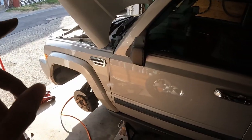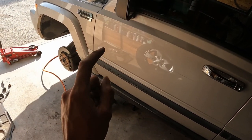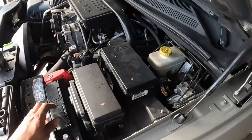The first thing I did: I blocked off the rear wheel so it doesn't roll, jacked it up, put jack stands on the pinch weld and the body because I don't trust the pinch welds, and went ahead and removed both tires.